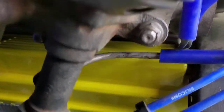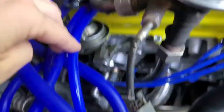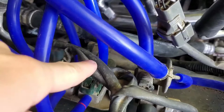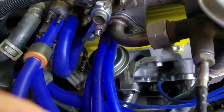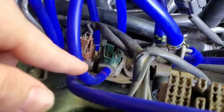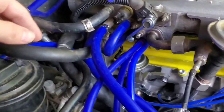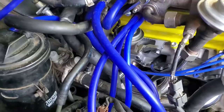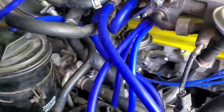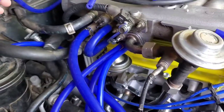Completing that EGR pass — as you can see, we followed those tubes to the first two lines here. One of them pulls off and goes to the green VSV down here on the close side, and then the next one goes back to the top of the green, and that should complete your EGR system. Now, I had to thin down my vacuum lines to figure out which ones went where because they're all different lengths. If you're cutting these, label them — I lost my notes, so be better than me.